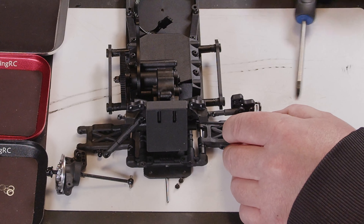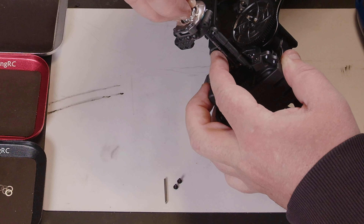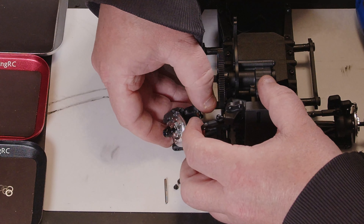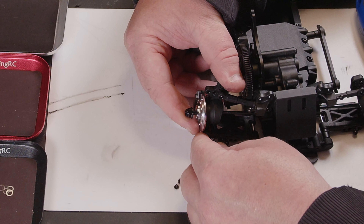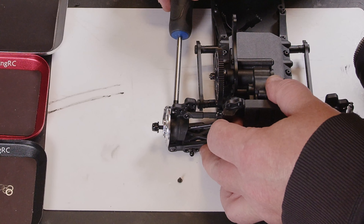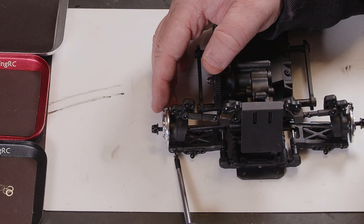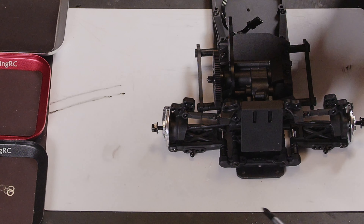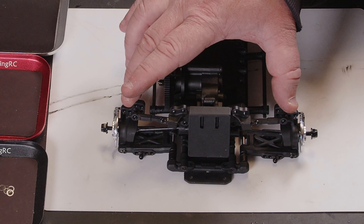These just go in one in front, one at back, and it just stops your hinge pin from coming out. For the opposite side, just spin the drive shaft till it drops into place — a bit fiddly when I'm trying to get it on camera but they're not too bad. Once you get that in place on the tie rod you want a tiny little pin, one little screw in the front of the arm, and again a tiny little screw in the rear — that'll keep the pin in. Suspension is pretty much in place; there's a bit of play but not the worst I've seen.